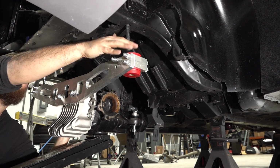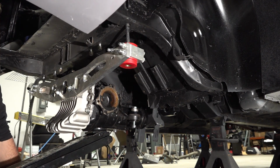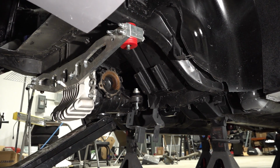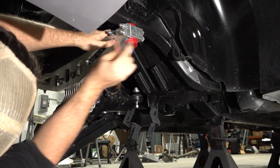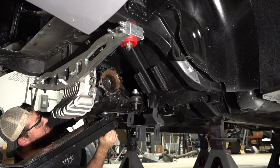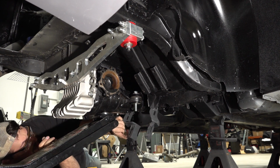This differential might be lighter than an R230, but it's still a substantial piece. I'll always recommend using a floor jack when removing or installing one of these. It's not worth crushing your fingers or cracking a cover, getting it most of the way there by trying to muscle it up, and then inevitably dropping it on yourself.